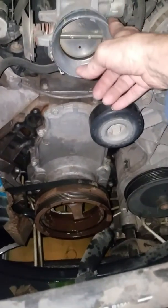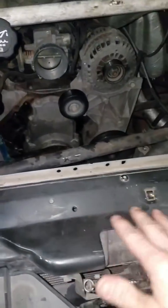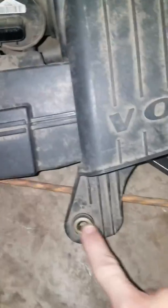The first thing you want to do is take the air intake off. There'll be a band clamp holding onto the throttle body, and then there'll be an electrical connector for the mass air flow sensor, and then a couple more bolts on the front. Right there's the band clamp, right there's the mass air sensor, and there'll be a couple more bolts right there, and then it should slide right off.